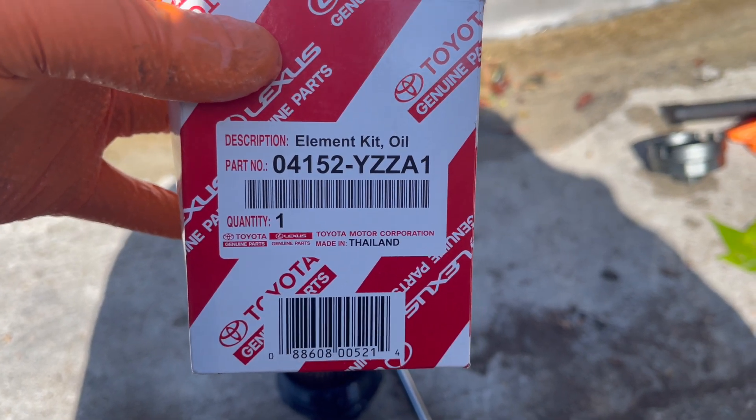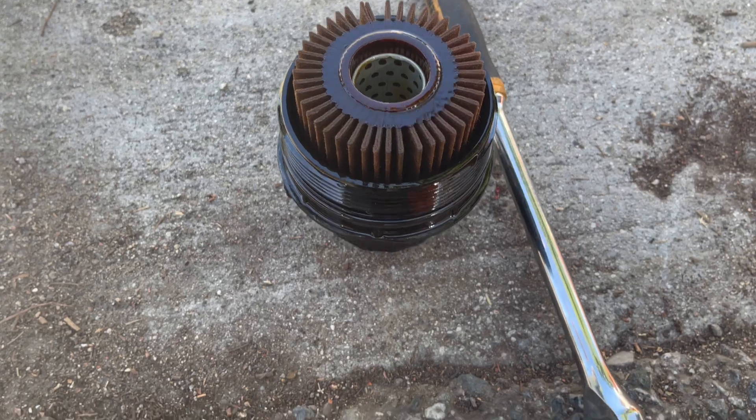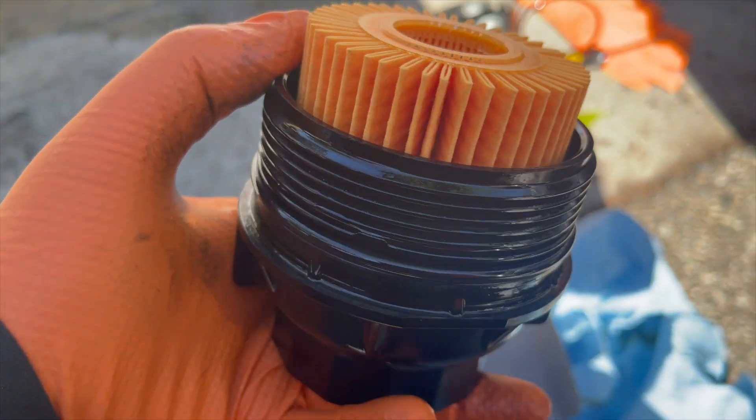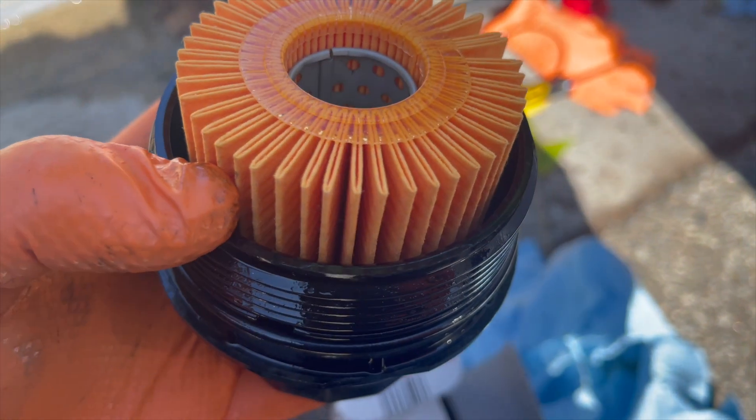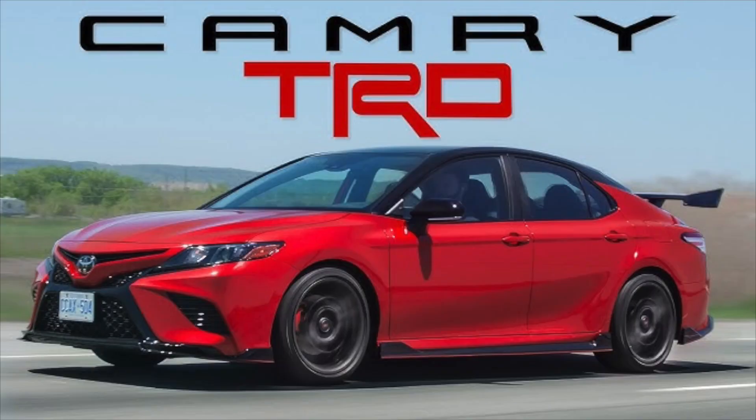So here we'll be using a genuine Lexus/Toyota genuine part — there's the part number for you guys — and there's the oil filter cartridge. There's the old oil filter cartridge, and we installed the new one. We put a new O-ring and new gasket on it. You want to make sure to install it correctly — not at the very bottom. Even if you get an aftermarket oil filter cartridge, it's still going to come with the two gaskets and the clear plastic drain tool that you guys see me stick into the oil filter housing to drain out the oil. Most aftermarket oil filter cartridges will come with that. We used the Toyota genuine part because it was pretty much on sale at the same price as some aftermarket ones — and why not use genuine Toyota OEM products in the Toyota.